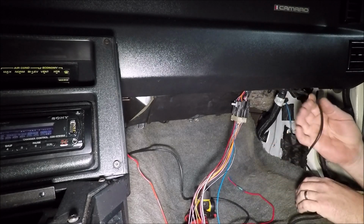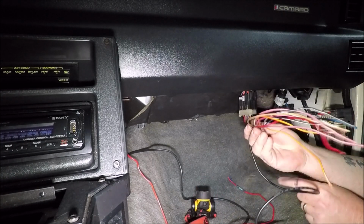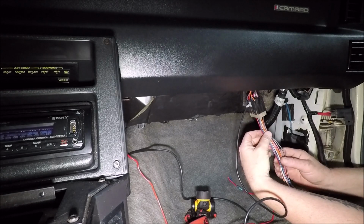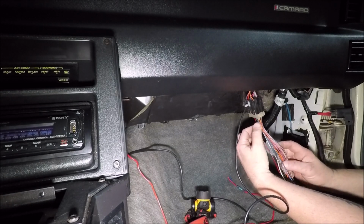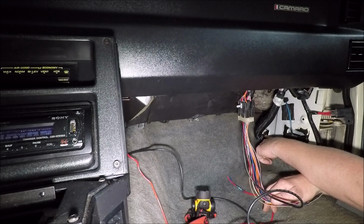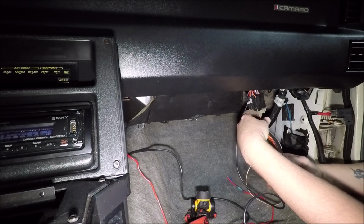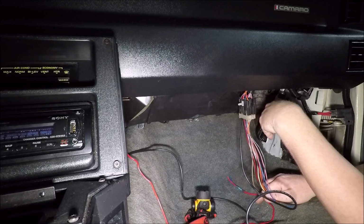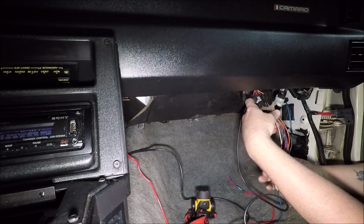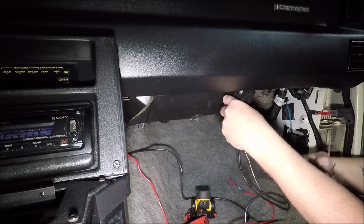PCM's up there. This cable here for my laptop, obviously, I'll probably just leave that flopping down here. And I've still got to go through my C207 harness here. I'm going to look for probably the wire that used to trigger the factory PCM to come on. I'm going to run that down here through the old bulkhead hole, and there's some wires on the other side for a ground and a power on for the Holley. So yeah, my plan's to use those, so I got to go through that. So when I finish with this, there'll probably only be a few wires still coming out of this. Everything else will be gone.